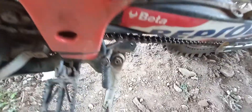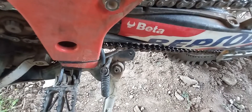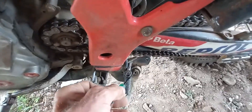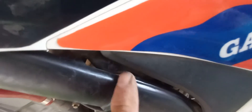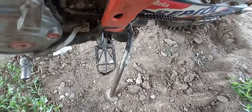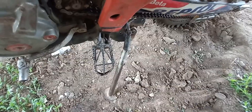If you're going to use the bike as a tool and not as a showpiece, cut that off — the bike will start in gear anywhere, anytime. The other thing that really annoys me is people leaving the sidestand switch on. Basically, the bike won't start with the sidestand down, which is dumb because if you want to tip the bike over and get the back wheel off the floor to fire it up and grease your chain, you can't. Take it off, follow the wire up to the rubber connector just inside there, disconnect it, bridge out the wiring loom side, tape it back up. Your bike will now start with the sidestand down — if you forget and crash, that's your fault, but most of us are intelligent enough.